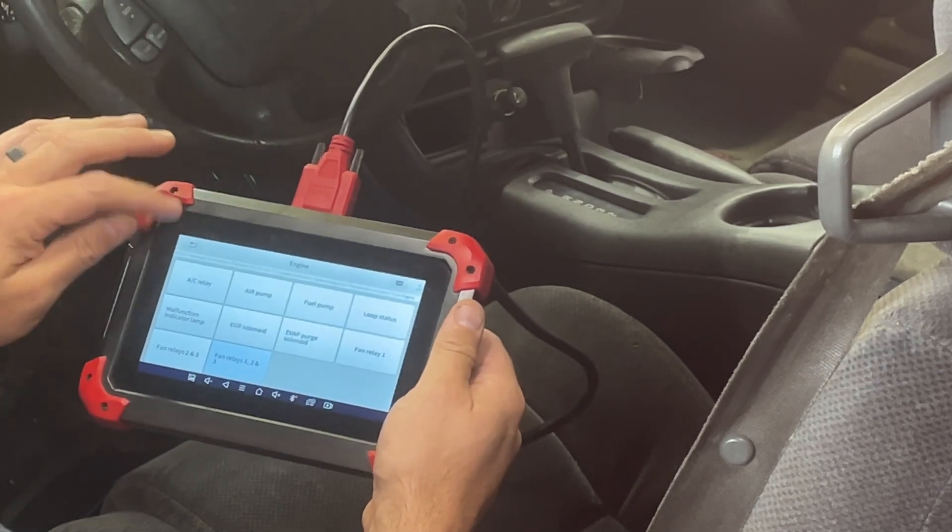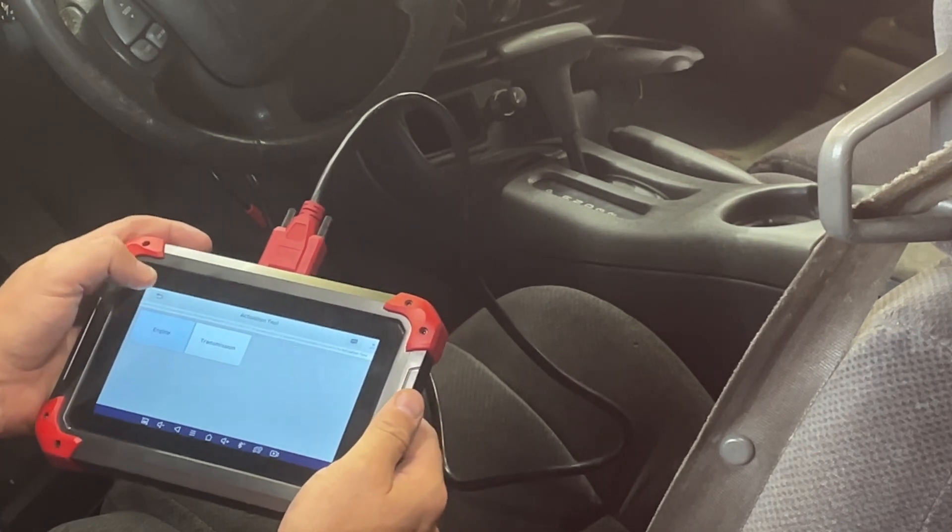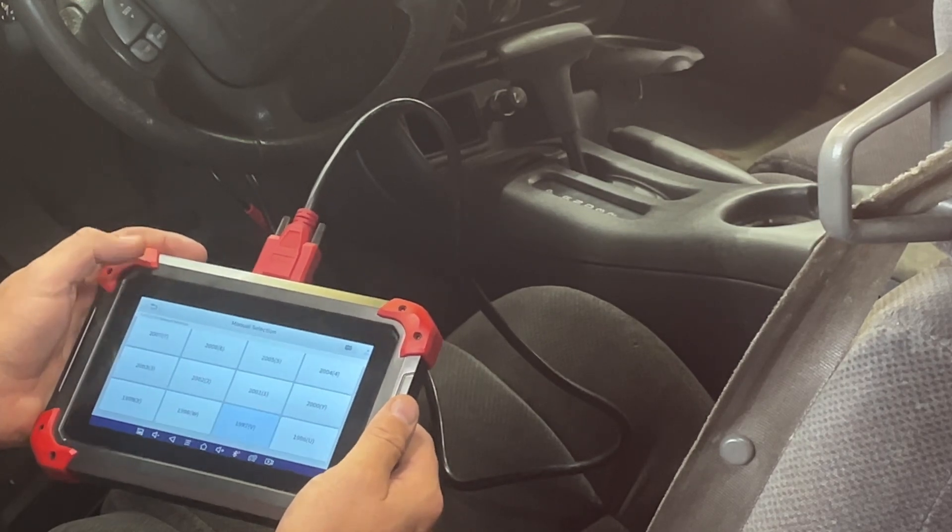So that means from computer to fan everything works — no wiring problems, no fuse problems. Something is not telling the computer to turn the fans on. And if it was getting hot enough to boil, it seems like the fans should be on. It looks like the fans are working, and that's good news. I'm not sure why they didn't kick on before, but everything from the computer to the fans seems to be set up right — no shorts in a wire, bad relays, bad fuses, anything like that. It could be maybe a bad sensor somewhere. The temperature sensor that runs the gauge is working, but maybe there's another sensor. I remember reading that in the LT1 Roadmasters or Impalas there is a second sensor — one on the water pump and one on the block. So I'll do some digging on that.